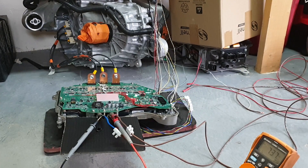Okay folks, very quick update. Model 3 drive unit, Model 3 inverter version 2 mod board fitted — we have full closed loop control now. I've just finished tuning sync offset and we're going to give her some Q current. We are spinning negative Q current for reverse.